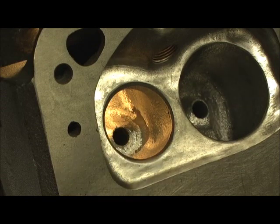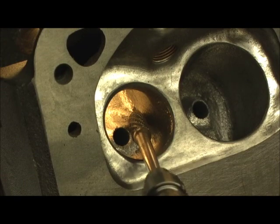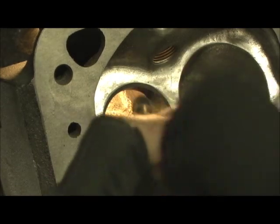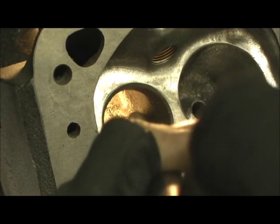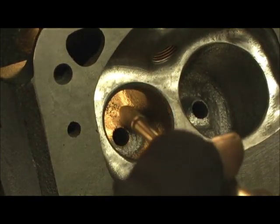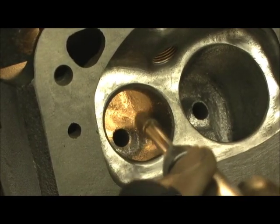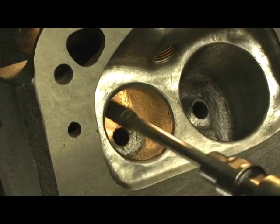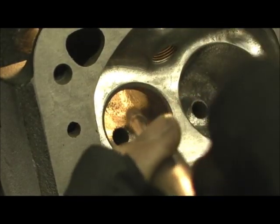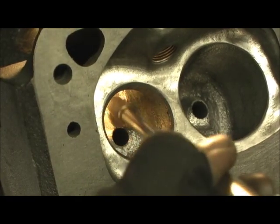We're now switched to the finger, and what we're doing here is there's a little shaded part I was telling you where the egg couldn't get to it. Now we're going to go in here. See how nice of a job that does? It takes those radiuses right out of it. Be careful when you're doing this not to let your carbide come down there and hit the seat — you'll sure enough be in a mess. But this right here finishes the roll on the top.